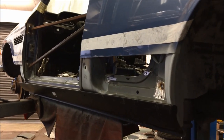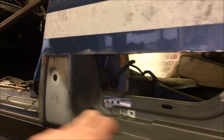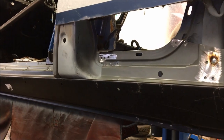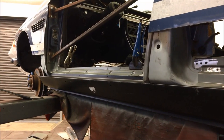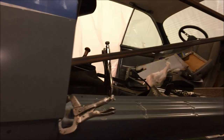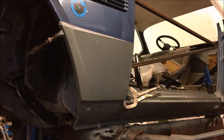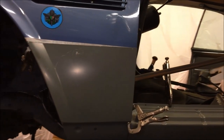We're now preparing — with the membrane, A-pillar, B-pillar, and inner rear wheel housing all repaired — to fit the outer sill. Before final welding, we need a trial fit of the outer sill cover just to ensure our panel gaps are absolutely perfect. Final measurements for the outer sill have all been taken and we're ready to spot weld it on. Then final measurements need taking for the lower front wing and lower rear wing repair sections, along with a trial hang of the door to ensure panel gaps are perfect before they are welded in.